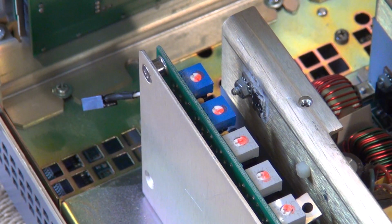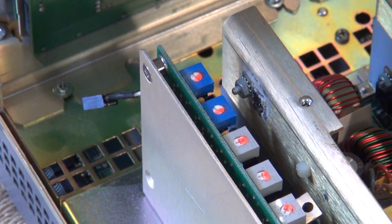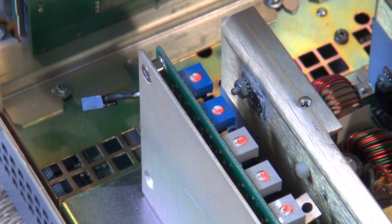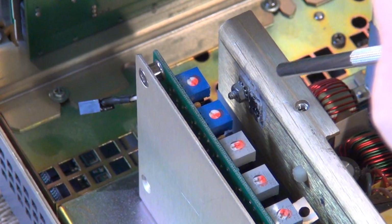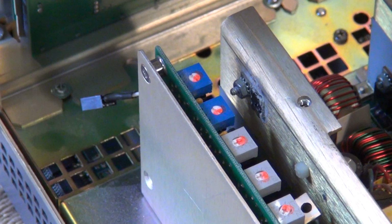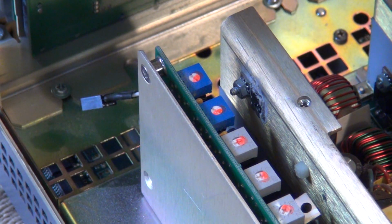I was looking around seeing where that 12 volt line went, and I noticed this TO220 package here hanging off that heatsink loose as the prom queen, you know what I mean? And I kind of thought it was a voltage regulator or something, and that it wasn't getting any thermal relief and either went into shut off mode or burned itself up. And while I was tightening it up, it snapped off, and a little piece of metal fell out, and you can still see the contact in there.